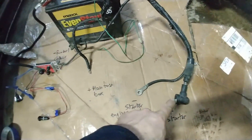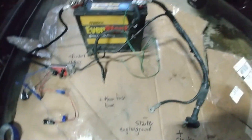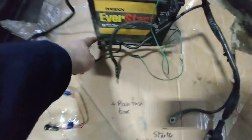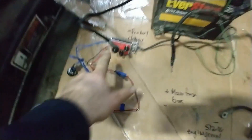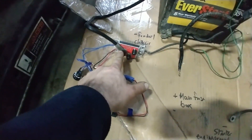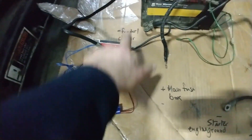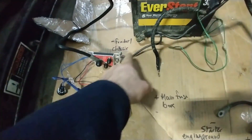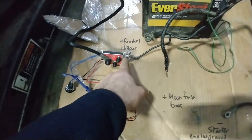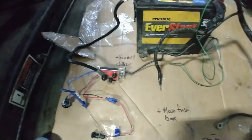With the CarTech GT, you don't touch anything on the main positive side — the wires going to the starter and to the main fuse box remain the same. You just disconnect your ground and instead run a ground cable from the battery directly to the negative post of the CarTech GT. You need to secure the CarTech GT to the chassis, so you can reuse where the original ground cable was bolted to the fender and bolt the CarTech GT there — your ground circuit is already ready.